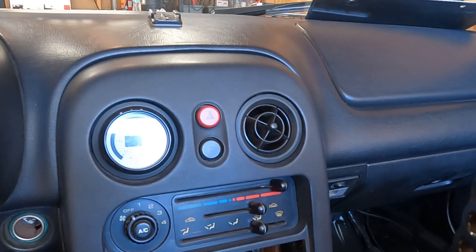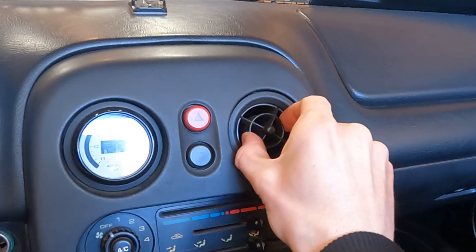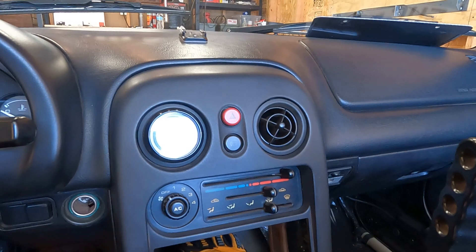As a reference, a manual boost controller is just controlled with a knob on top — you turn it for more or less boost. Pretty simple and easy, as long as you have a boost gauge to monitor your boost levels. Installing a boost gauge does require a little basic wiring. You just need a power and a ground, but the 12 volt power needs to be ignition on/off, and it should be run through a fuse or relay so it doesn't drain your battery.